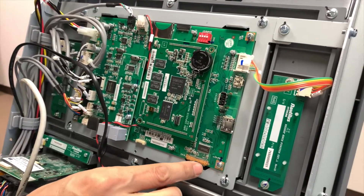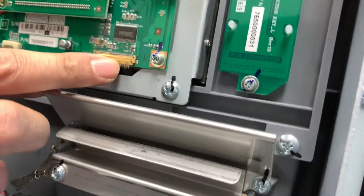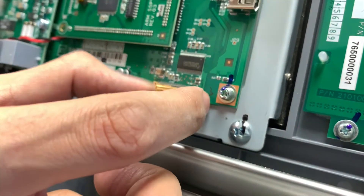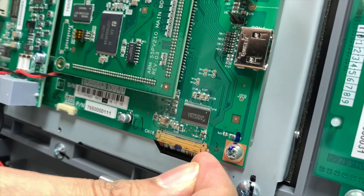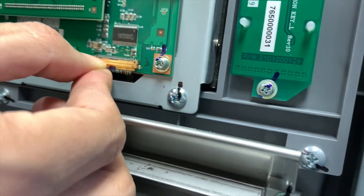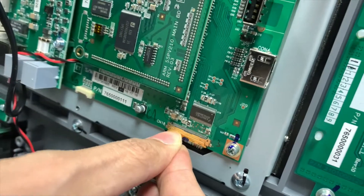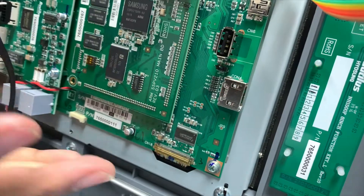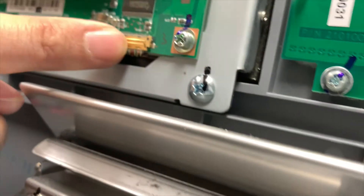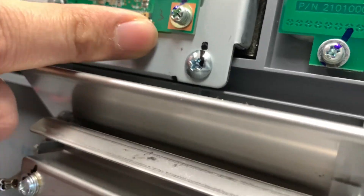One very important cable I want to bring to your attention is the LCD cable over here. It's a very, very sensitive cable — you want to be careful. There are different types of connectors on this, but the bottom line is you're really just pinching this connector off. It's a multi-ribbon cable which is connected in a small little slot here. You want to be careful of that.